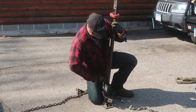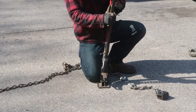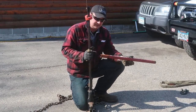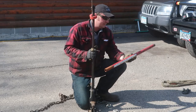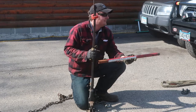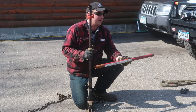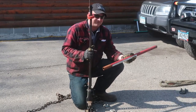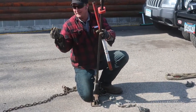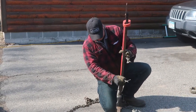This is what happens when you don't grease your gear, right? It makes an easier removable handle. I ran Jeep XJs and ZJs for a lot of years. If you're running stock steering linkage, this will fit right over it if you bend a tie rod. To get you off the trail, you can spin it off, straighten it out, slide it over, and then it won't rebend on the way back to camp. I've done it before. I've added this pin for the easy removal of the handle.